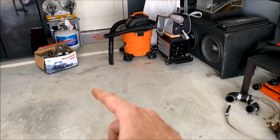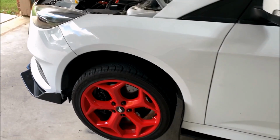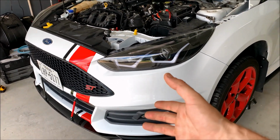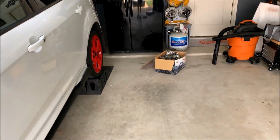However, when I go to put the stock turbo back on, I'm definitely going to have to take the cold side charge pipe off. With that being said, for my next video, I will probably be removing the cold side charge pipe, disconnecting the tial blow-off valve, probably have to take the front bumper off to do all of that, and then I will hopefully get the stock turbo reinstalled.